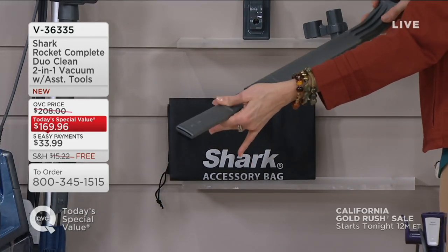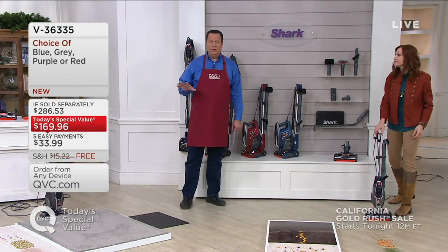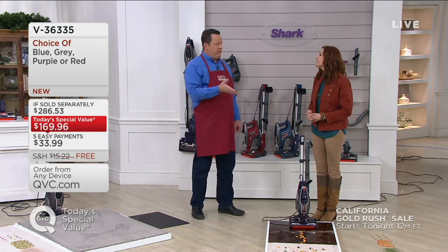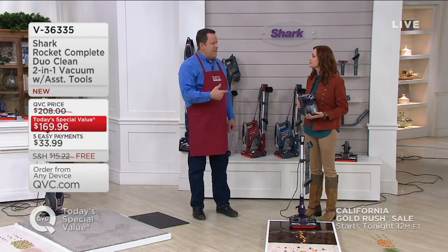tools, David. Can I also ask you, when was the last time you cleaned the dust on your refrigerator? Raise your hand. I'll wait. Maybe not never? Not many hands going up, right? You know what happens when that air intake area at the bottom front of your refrigerator gets covered? It makes your refrigerator work harder. The compressor is working harder to get fresh air so it can refrigerate the contents inside your fridge. So if that remains clogged for too long, then that compressor can give out, and then you're facing a big repair bill.